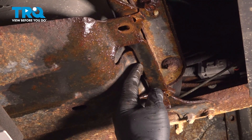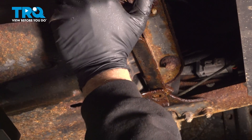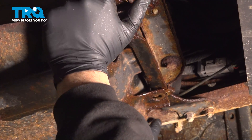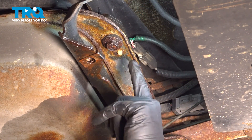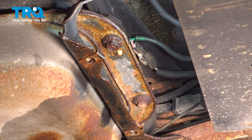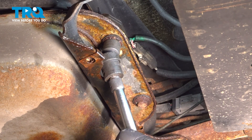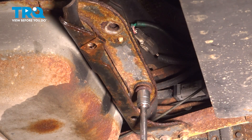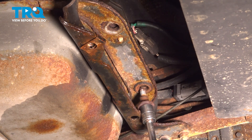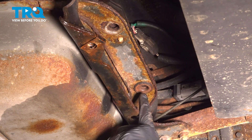There's a tab up underneath this brace here supporting the front part of the gas tank shield. On the front side we have two 18-millimeter bolts. Before you remove these, make sure that you reposition your gas tank jack underneath the vehicle. Loosen and remove these. In order to get this bolt out, we did go ahead and pop off the little retaining clip right here to get a better shot at it.